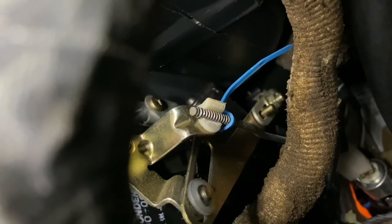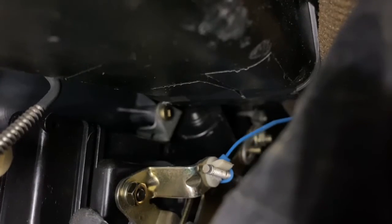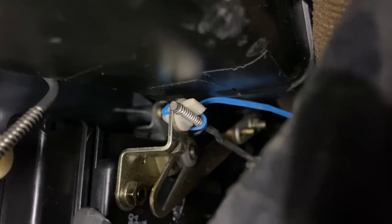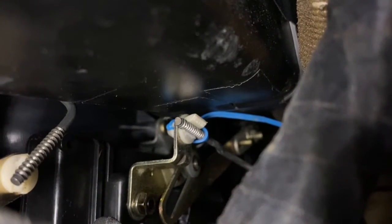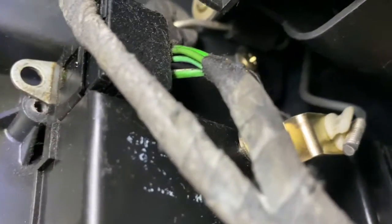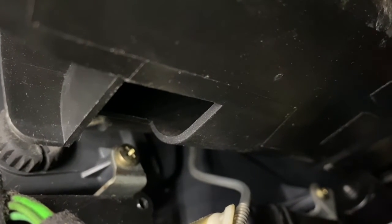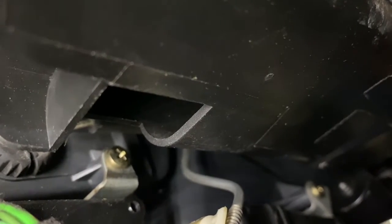So if I turn the heater knob — I think that's hot, I think that's cold. Removing that screw and the one below to release the servo — there, that's fine. Now I'm left with the screw which is being fouled by a plastic vent which I presume directs the hot air to the footwell.